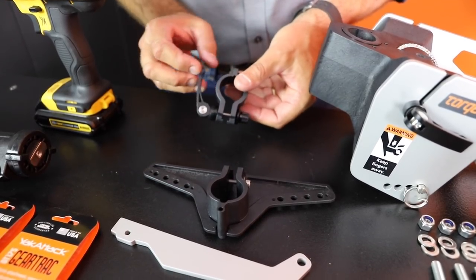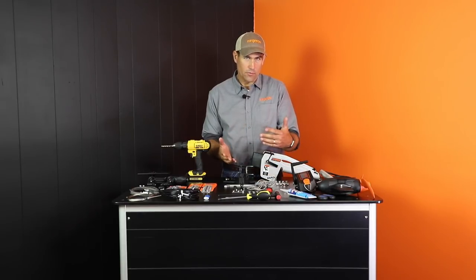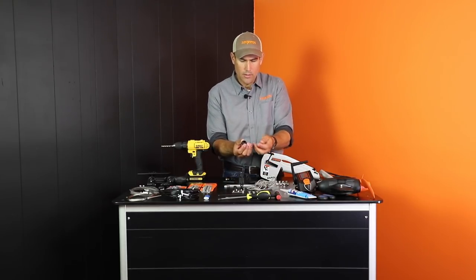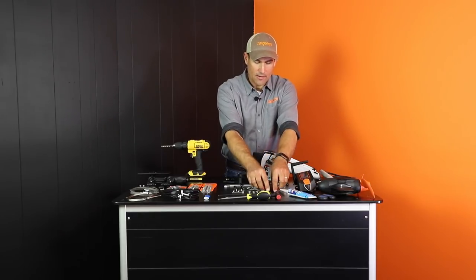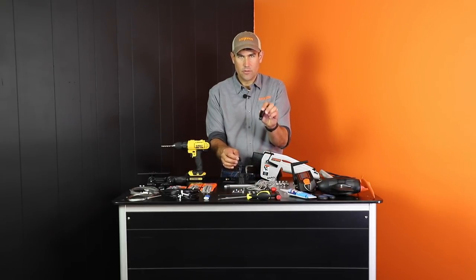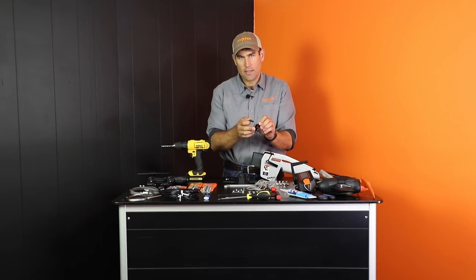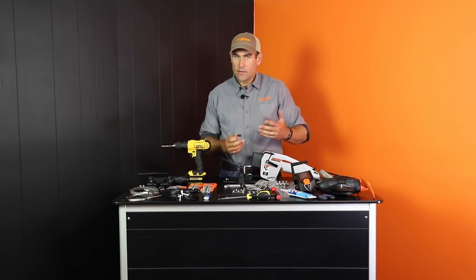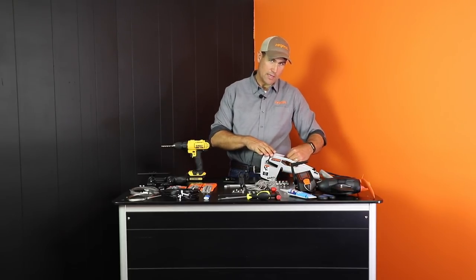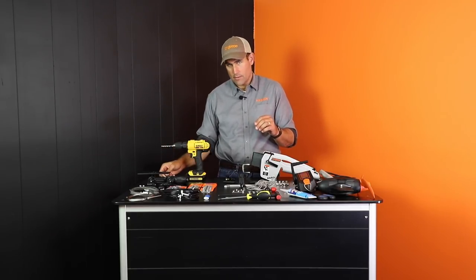Also with the Ultralight 403 AC, you have this cord, which is for your lift line. It's also for your reverse lock line. And for each of those lines, you have a small little knob that you tie off to the end of that. And you have track mounted hardware. This is the cleat. We use the cleat for the motor lift so that when you pull the motor up, you can snug it into that jam cleat and it stays put. For the reverse lock, because we don't want to really lock it in the reverse lock position, it's just a line guide to help you always know, hey, it's right there.